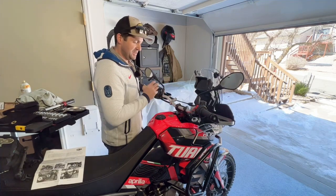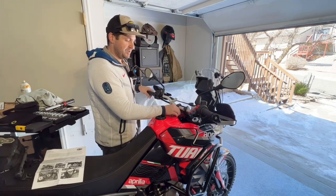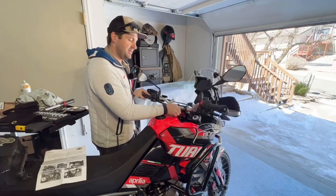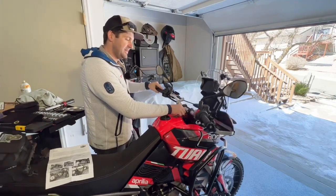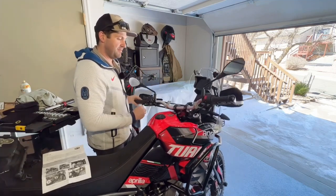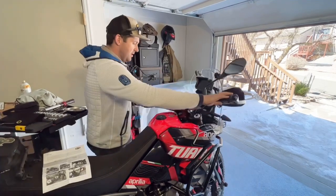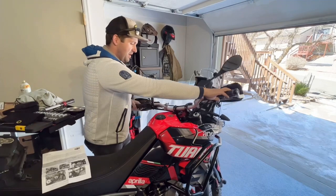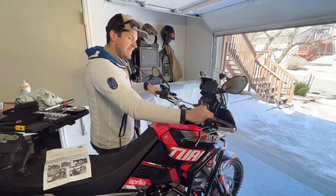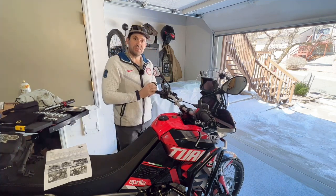Install is complete. Very happy with the fit and finish here and how it came back together. Very happy with the tactile knob — being able to go from minimum damping up to level eight, which is max damping. It's just very quick and easy on the fly. There's eight, then there's one, and then all the settings in between. Looks like setting five to five and a half is where mine's going to be living — a pretty good amount for me. It provides quick damping to steady out the front wheel as it comes back straight. It seems like it's going to work great. Stay tuned for my riding impressions.